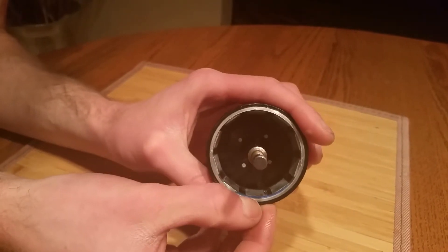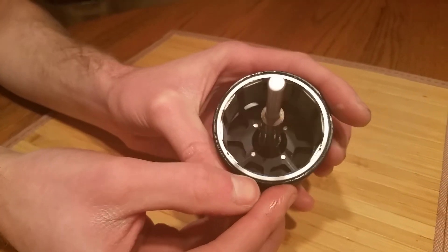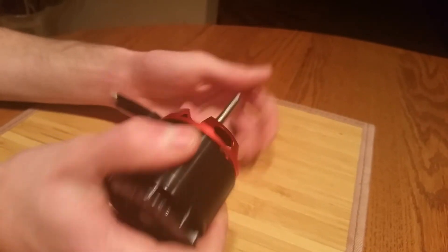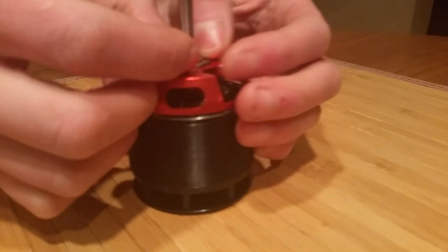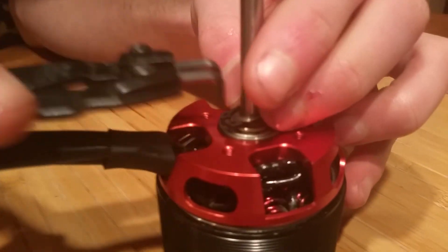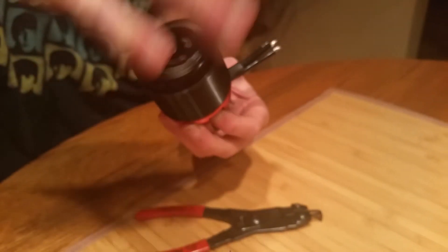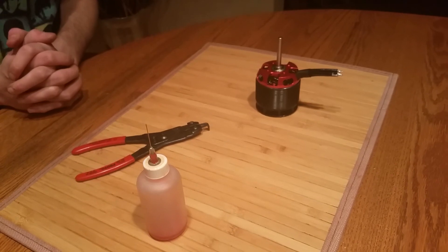Be careful — you're going to notice there's some blue putty. Don't pick that off, because this putty is balancing putty. It balances the motor so that it runs nice and smooth with no vibrations. The next thing is to take your motor and pop it together just like so. Take your brass collar and slip that on, then take your retaining clip and pop that on as well. You're going to notice your motor should run very smooth, and this will help extend the life of your motor bearings. Hope this video was helpful — please subscribe, and have a nice day and flying!